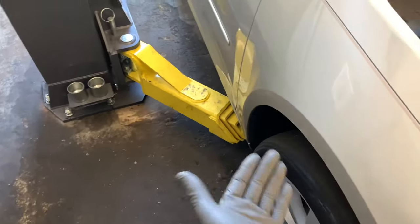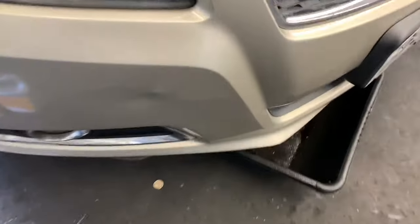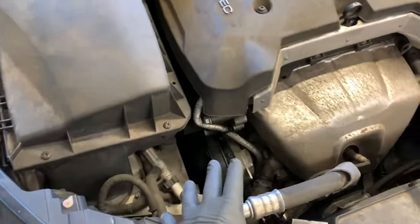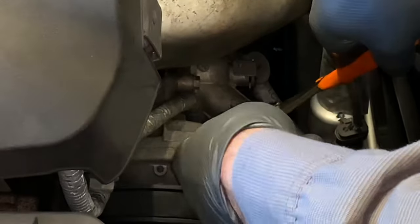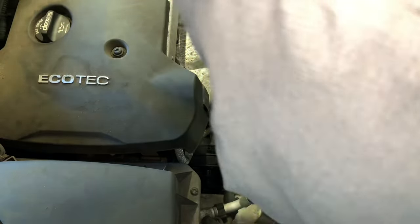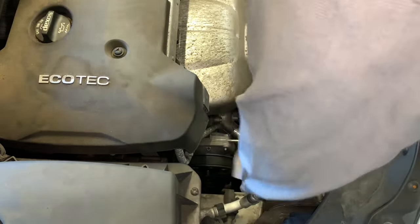I had to jack up the front of the vehicle just a little bit so I can get a coolant bucket to slide underneath to catch the coolant when we start draining it — you can do this with a regular floor jack. The first thing I did was take off the lower hose. I used a pair of hose clamp pliers to squeeze the clamp, slide the lower hose clamp back, then wiggle the hose and pull it off the thermostat housing.